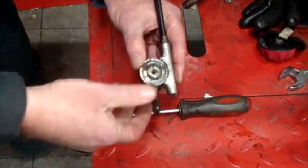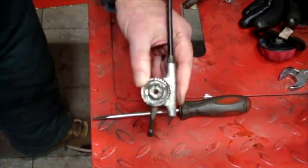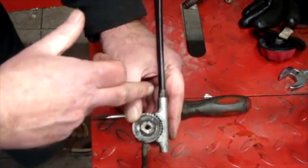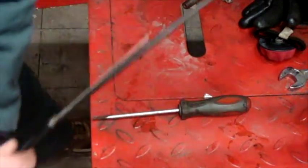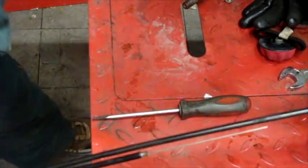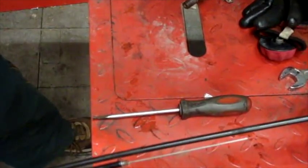I'm going to go ahead and mount this on the bike. I did lube these cables with some chain wax — that's usually what I use on my cables. It's for chain and cables. Once I get this back on the bike I'll tighten these down all the way. You also have to take your barrels off the other end of the cables, and they just thread back on to this part of the little spring in your cable. My other ones were all cracked up and really stiff, so this should help that out a lot.